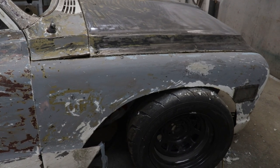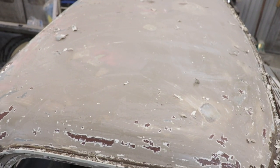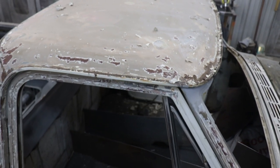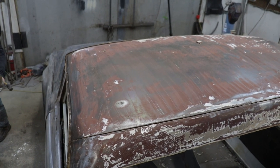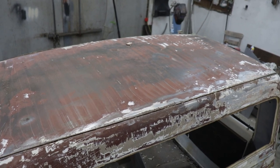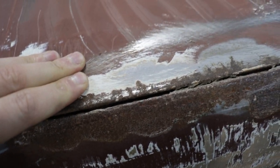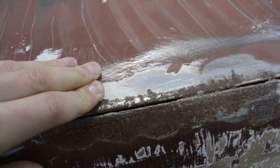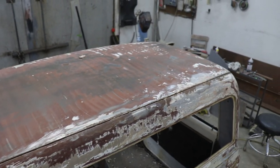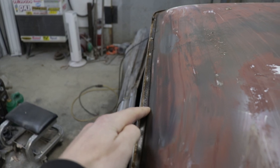Now that the door is ready to go, I'm going to move on to the roof. I thought the roof was going to be pretty bad, but once I started peeling off the paint, I saw a little bit of body filler and it got me pretty nervous. Honestly though, it looks pretty good — there's not much fixing to do. They had just sanded down a couple spots where it probably started to rust. The only problem is that now on the edges of the roof it's starting to rust again, there are spots with holes, and in the back the two pieces of metal are starting to come apart. So I'm going to cut the edges of the roof and peel it off to see if there's a nest throughout the entire roof.